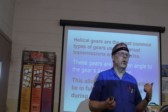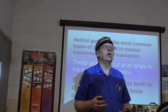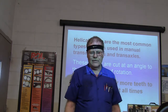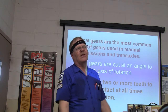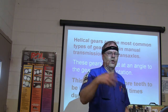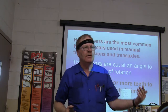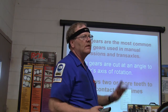I was working at a Mazda dealership back in the early 80s and pulled a transmission out of an RX-7 with that same problem. I knew exactly what was wrong with it. I steam cleaned it thoroughly to push all the oil out, then put it on the bench and opened it up — it was like working on brand-new parts. I had to put an input shaft bearing in it. As you understand power flow on a manual transmission, you'll understand why that input shaft bearing is the only one that's not loaded when it's in fourth gear.